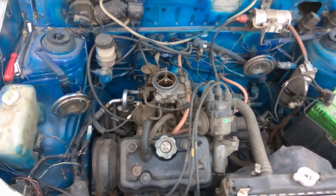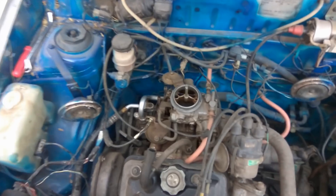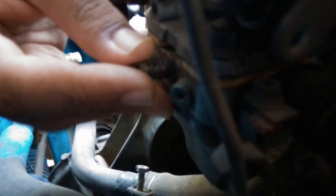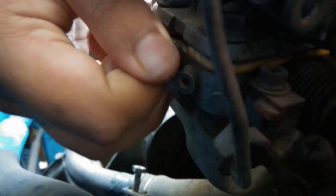After you remove your air filter, the first step is to adjust the carburetor fuel-air mixture screw. Go to the back of the carburetor and locate this screw. This screw adjusts the fuel-air mixture — how much fuel goes in for how much air. What you do is completely tighten it until it no longer goes further, no matter how hard you try. That is the fully tight position.